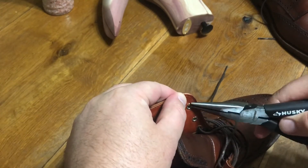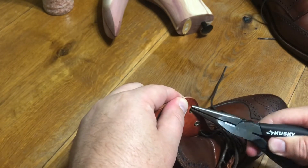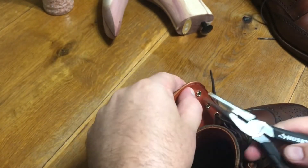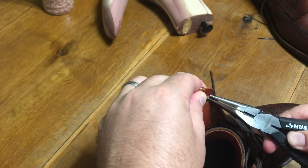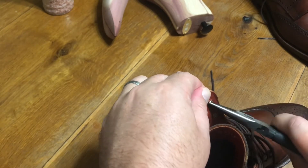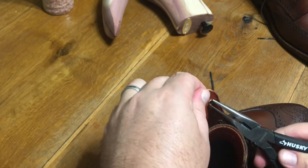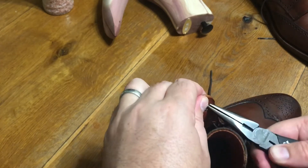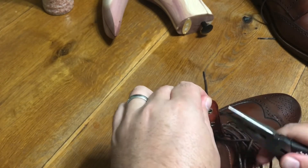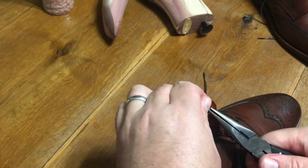The first step is to work loose the grommets. They're folded over on the backside of the boot and the petals can be lifted up one by one. It's pretty time-consuming, but I worked through them. If you didn't mind destroying them you could probably take them out with a drill bit or a countersink bit, but I intended to reuse them for another project. They're a little mangled but I worked them out with pliers. Later in the video I find it's easier to pop them out from the backside with a pair of side cutters rather than pliers, but overall not too bad to get them out.